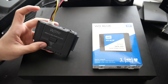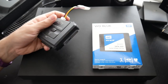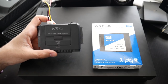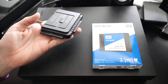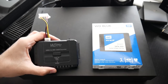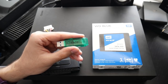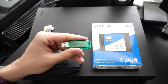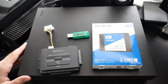We're also going to need something to hook it up to our PC. If you want to do it through USB, you can use any type of SATA to USB adapter. I'm using a USB 3.0 adapter that takes any type of IDE or SATA interface and adapts it to USB 3.0. For our final piece of hardware, we also need a USB flash drive of at least eight gigabytes in size. We must format it to NTFS, and we're going to load an update file onto it.